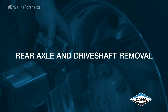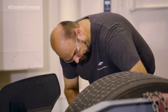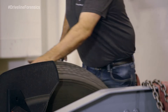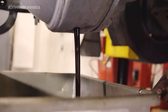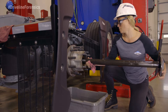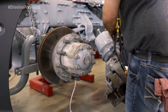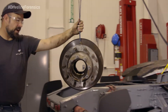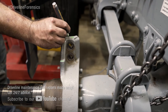So if you were taking out the axle and drive shaft with the intent of putting them back in, you would want to mark all of the connections so you could put everything back in the same way it came out. But since we're putting in all new parts, we're going to skip that step and start by taking off the lug nuts and pulling the tires. Then we'll drain the oil from the axle housing, pull the axle shaft nuts from the hubs and fully remove the axle shafts. Now we're going to release the park brakes to cage the air chambers, take off the calipers, remove the spindle nut that holds the hub, and take the hub off the axle. I'm going to make a note of the clocking of the torque backing plate so the orientation is correct when we put everything back in.